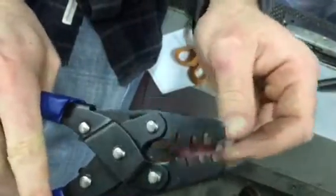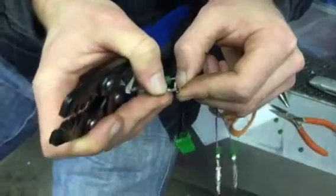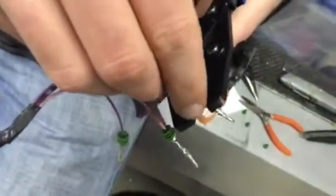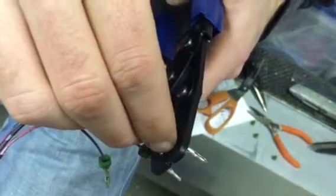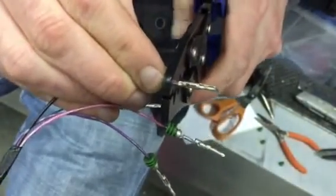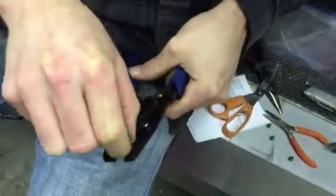Now it's starting to crimp. We put the wire in — the grommet's already on, already down the wire. Now set it up so that the dimple is on top, which means these little folded parts need to go to that piece there. Try and get it so it's centered. It rolled on me a little bit, but it should be okay. Now just squeeze — and that's really tight, so it should be good.